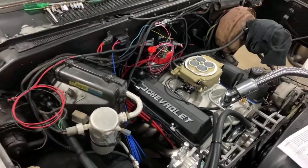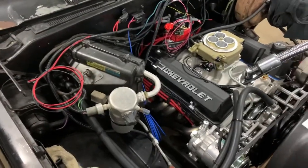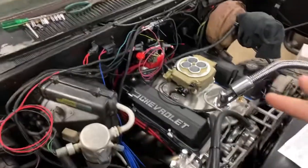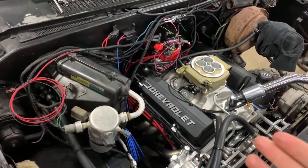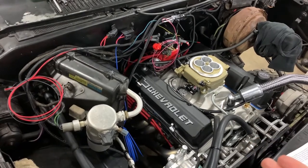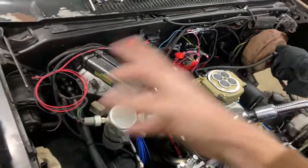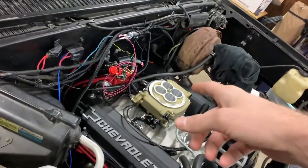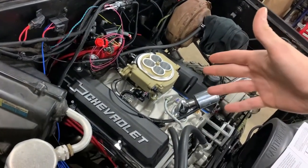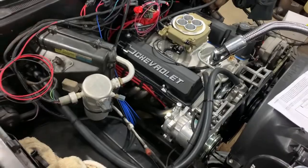I already got my wire ran, and all I gotta do is make the connection and tie up some of the wiring because it's too long. Now I'm working on the rest of this. And that brings me to my other point. So far, the biggest aggravation I've had, other than where that exhaust bung is, is that the wiring is so freaking awkward. The lengths, like, they're either a little too short or too long. Most of them, length is fine on this because you can cut off whatever you need. But like on these connections, the O2 sensor wire is long enough to reach the O2 sensor itself pretty much. So then you got the O2 sensor, which also has a bunch of wire, and then you're going to have to loop it around, tie it up somewhere. You don't need all that wire, but you know, it's whatever.